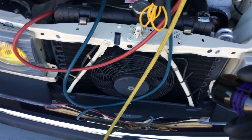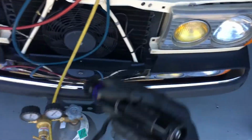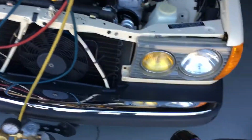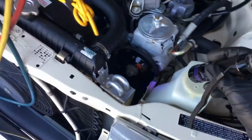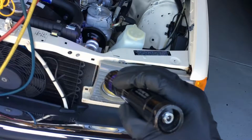This system does have dye in it. See, I got my light there. You can't see it now, but the first thing I do is a visual on the vehicle. I popped the caps off, and I noticed there was dye inside the thread, so I know somebody touched it before and looked for oil. This has the old Pancake R4 compressor, notorious for the case seals drying up, getting hard, and leaking at the case seal.